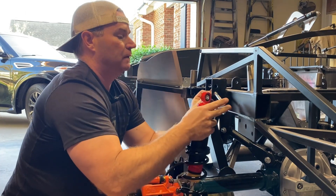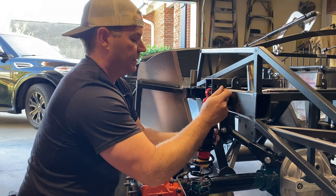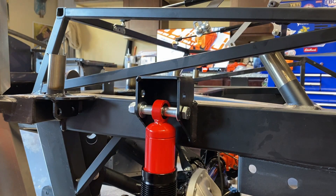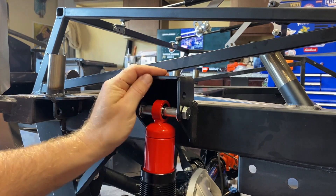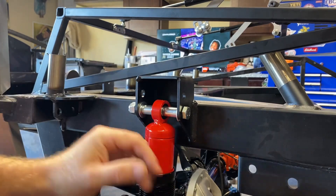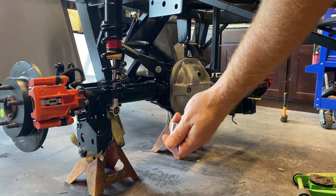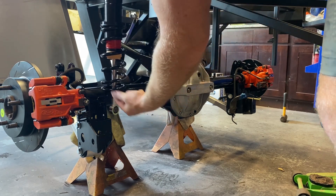You also need to add a washer — I think it's an inch spacer for the strut, plus the other spacer and a washer. For the bottom, there's a ride height decision: when we put the lower control arm we put it on the lower setting to make the ride height lower. We want the same here because we want the car low — very little clearance is the look we're going for. We don't want it jacked up with a big perky butt, so we're moving to the upper mounts to get lower to the ground. Connecting the lower strut — the bolt we put in earlier actually got a bit stripped. There are also nuts in the kit for the back side, and you need another spacer not provided; it goes against the axle to push it out for proper geometry. So we jack up the rear end and get this installed.